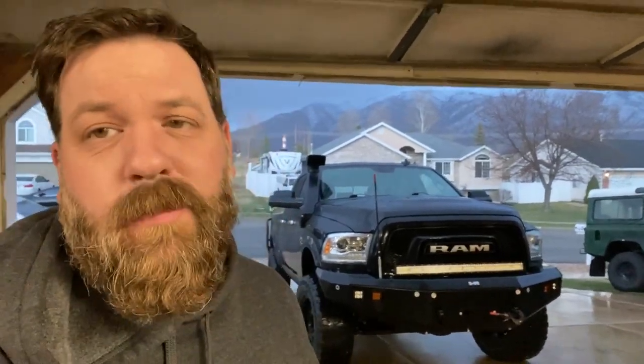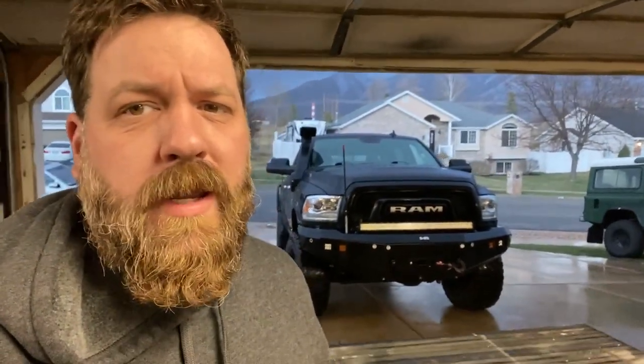Keeps stuff pretty safe. Never mind the hair. We got welding here, boys and girls. The truck is all done with the skid plate, didn't take too long, about 3 hours or so. We put some metal etching primer on it, and then we painted it with some black spray paint so it matches what's already there, black. The whole truck is black, except for the headlights and the ugly chrome door handles, but it's getting there.